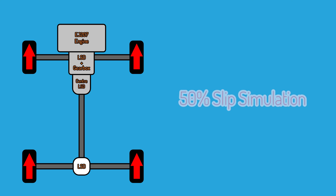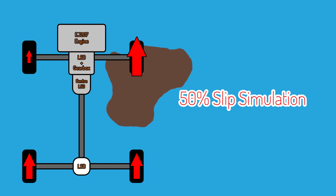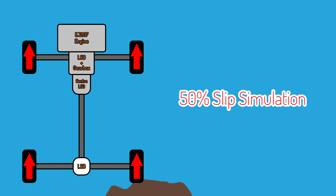Here we have a simulation of how the power would be diverted if the car were to accelerate through a muddy puddle. I'll show a 50% maximum slip on the front and rear differentials just for reference. As we can see, while some power is wasted spinning the slipping wheel going through the mud, the wheels that are actually on the tarmac and have grip are still receiving at least some torque. On the track, when turning extremely sharp under full acceleration, the wheels may start to slip a little, but it will not cause the car to one-wheel peel.